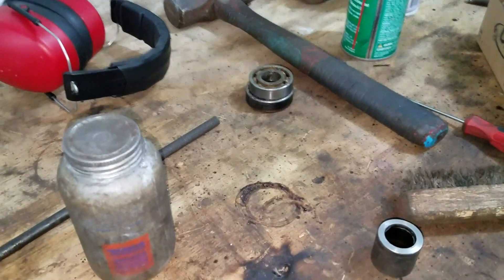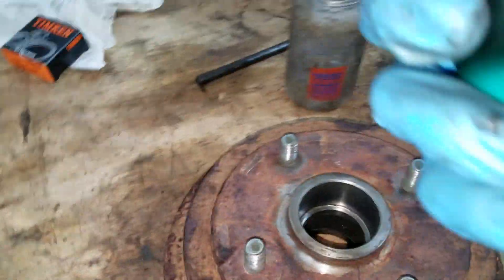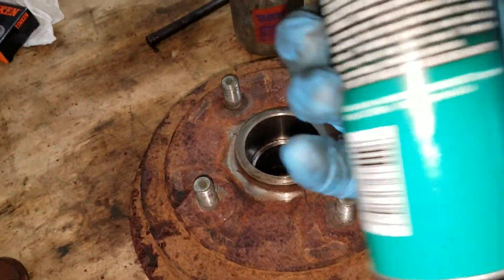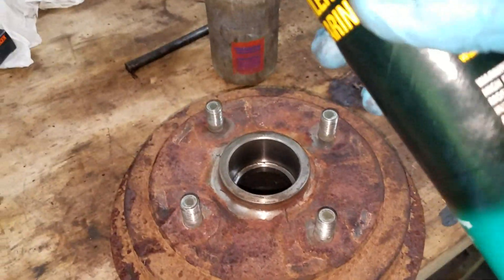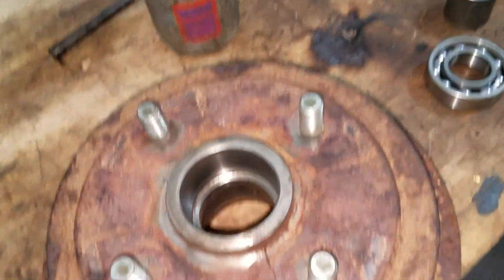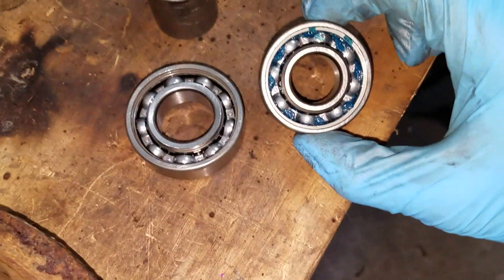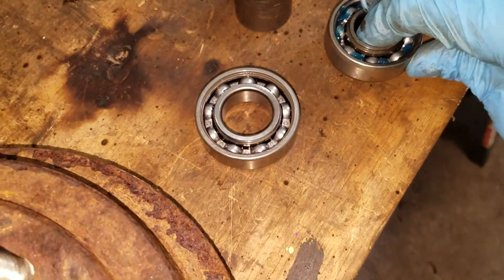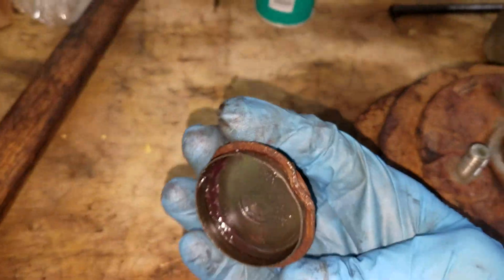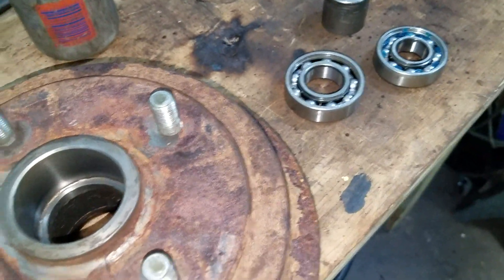That allows the grease to contact areas of the hub that aren't just the bearings so it can cool, and it can flow between the bearings and wear everything evenly. If you look at these old bearings, they're actually worn somewhat evenly — one isn't way worse than the other, and if it's set up correctly, that's not too common. There was also pretty much no grease in these. What I'm thinking the last person did is they left the grease that came in the bearings. This one's got a little bit but the other has no grease whatsoever. Looks like the last person also didn't add any grease other than what was in the bearings — so yeah, no wonder it failed.